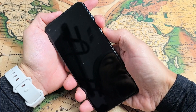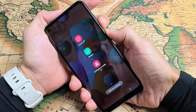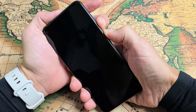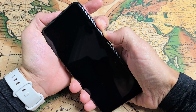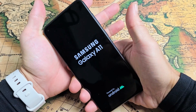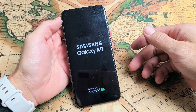Let's do it together — volume down, power button. Press and hold both buttons. Don't worry about what's happening to the screen, just keep holding both buttons until you see the Samsung logo appear. It vibrated. Still holding. There it is — go ahead and let go and see if you're out of the boot loop now.